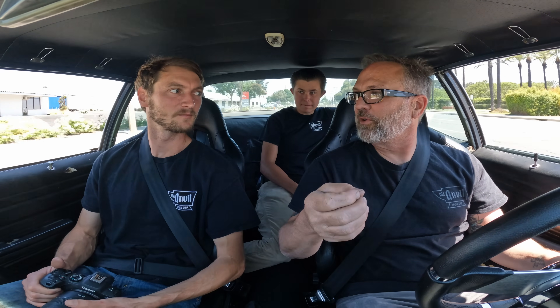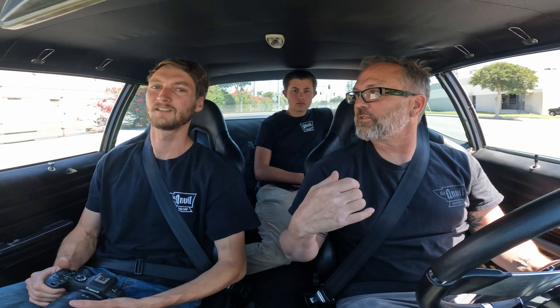Then I tried to be lighter on the pedal and still couldn't do it — it would still lock all of them up. So we adjusted again and tried it, and we were so close that it doesn't really make any difference. It's so close to locking them all up that we couldn't even get it on the photograph. We can feel in the car that the back is definitely grabbing and making more noise, but the front has so much bite because of the weight on the front. The weight difference, the driver difference, how you get into the pedal — it all makes a difference.